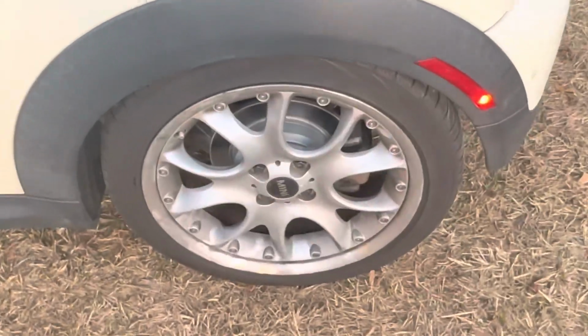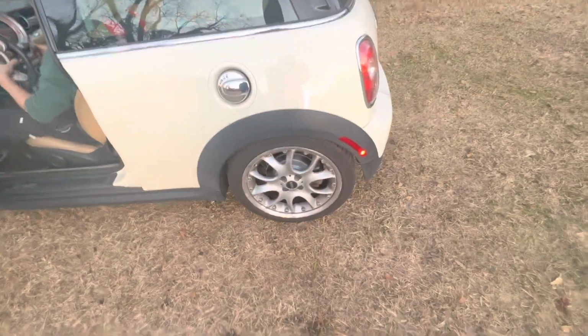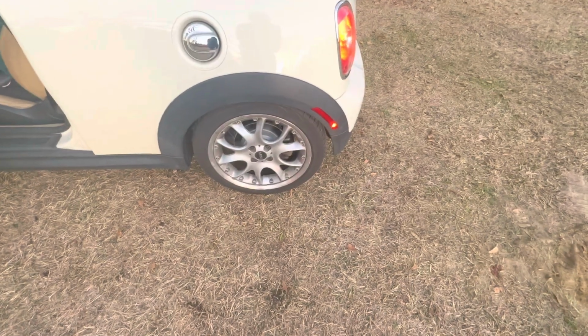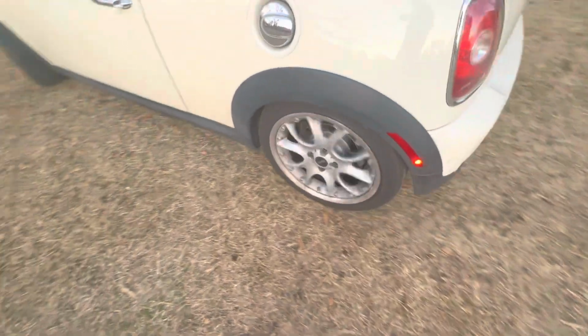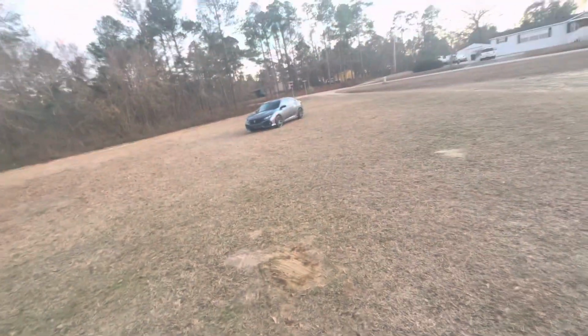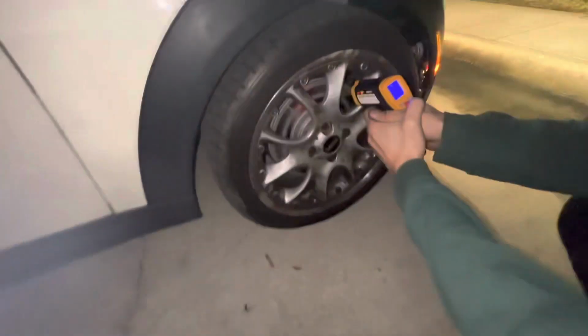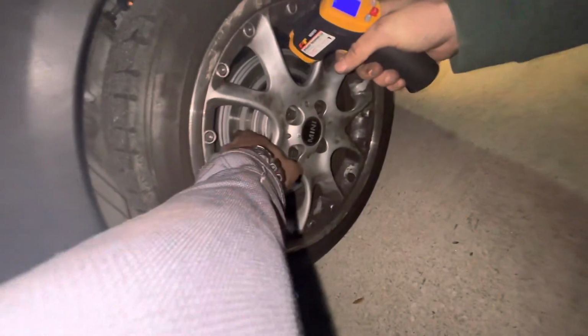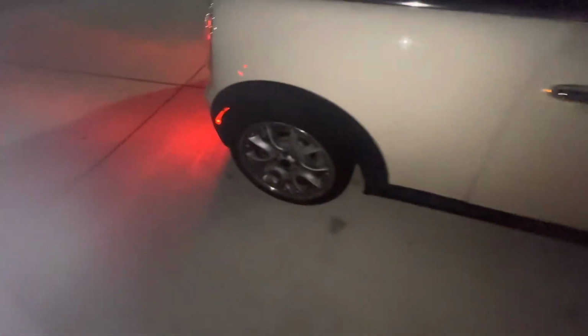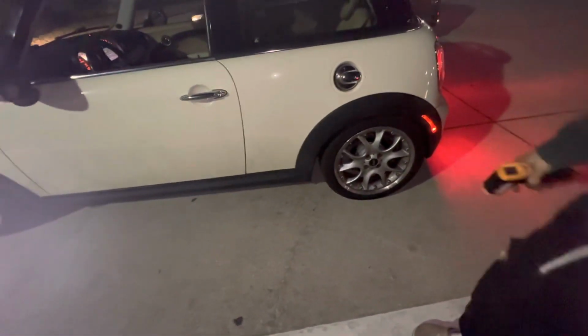Yeah, that's true. Everything is good besides this one rotor right here, which is rubbing. So the pads are rubbing on the rotor. You can hear it when he pulls off. Or not. But it's overheating compared to the others, so we're gonna be back again tomorrow. That stuff is hot, but that's on the front, and then that stuff is cooler. I would say that's because that's making contact with the brake pad, and that's not. The overheating problem isn't necessarily a problem. It's not gonna burn up anything. They're wearing kind of weird, but they're good.